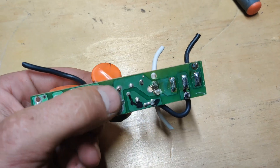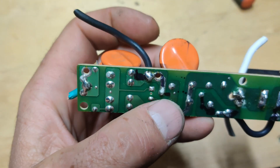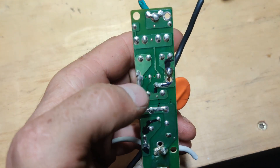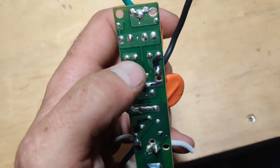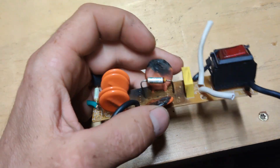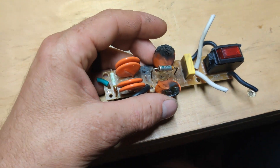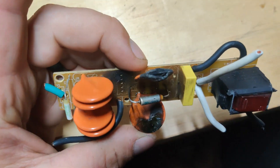This thermal fuse carries our line over to right here, and then we have two varistors on this side that eventually end up at ground through that fuse, and two varistors on the neutral side — they added some extra there for that trace. Both going through that fuse. This is a TG113 — I'm pretty sure that's Celsius, because 113 degrees Fahrenheit would not be too hard to overcome. Anyway, we can see that this thing blew out on the side here, straight onto that fuse, and then out through the top also.